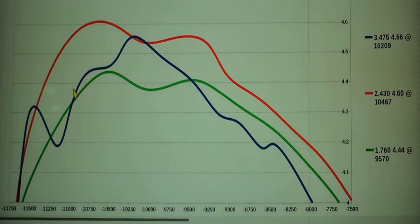Now the red line — even though it looks different — if a guy was to only look at the dyno numbers, you'd think there wasn't much of a difference, because we only gained four hundredths of a horsepower. We went from 4.56 to 4.60, which isn't much, and we gained 250 RPMs. But look how we flattened that out — we gained the whole time, all except for this little anomaly right here. So while you lose horsepower slower with a longer pipe, the correct length of pipe really flattens this curve out plus gets you the most horsepower.